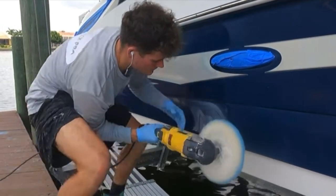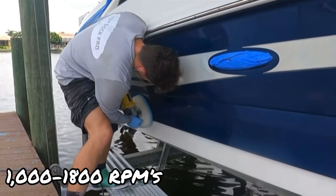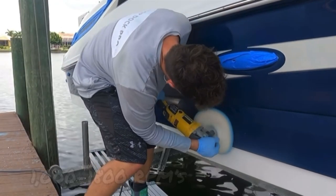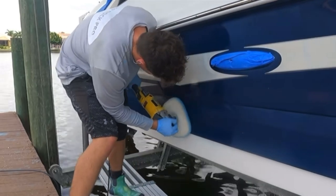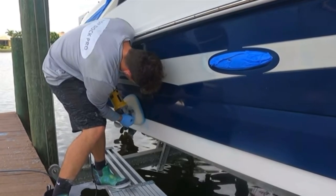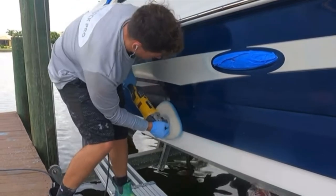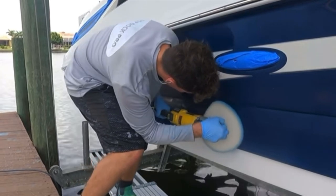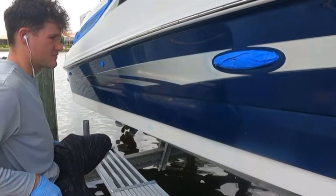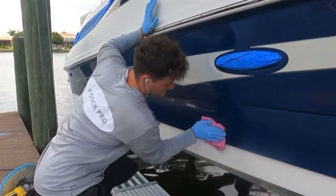When running this pad, I usually run it around 1,000 RPMs, and then I finish this pad around 1,500 to 1,800 RPMs. How I hold it: I'm going to tilt the machine on an angle so that I can pressure all of the pad into one spot and cut out the most oxidation and scratches. Then once I run a few vertical and horizontal passes, I'll finish the pad out flat against the surface to leave the best finish. One of the cons is going to be swirls, so we want to finish this pad flat.